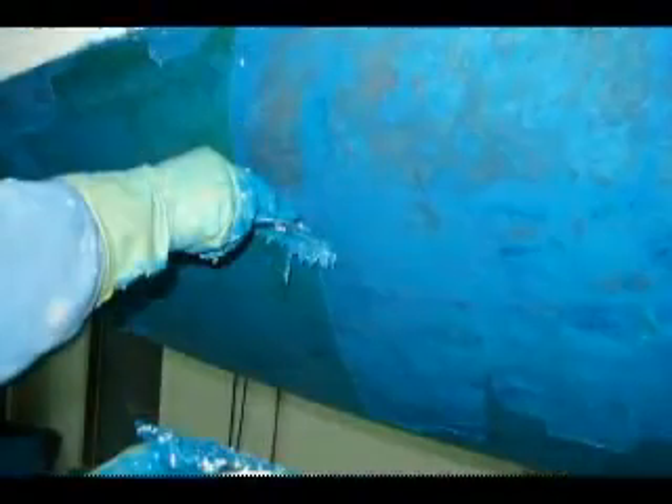The process started at 8 a.m. when we sprayed three gallons onto the hull. Kevin got busy on another project, and four hours later we came back to find that the multiple coats of anti-fouling paint had softened to a point where it could be removed to the gel coat with a putty blade.